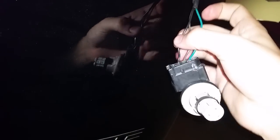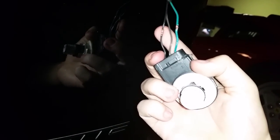Now, this is what you have — this is for the right side. There are three wires. I've already split these open a bit, which makes the T-connectors connect a little better. There's a green wire, and on the other side it is yellow. The outermost wire will control the actual turn signal. This black wire on the end is your ground wire. This one in the middle is the one that causes all your problems — this controls the DRL circuit.